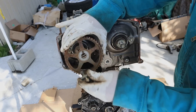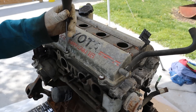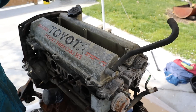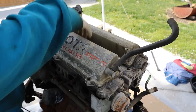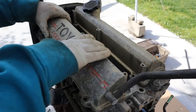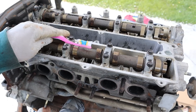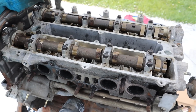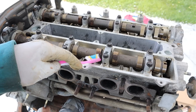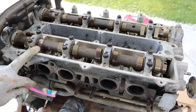Let's remove the camshafts. The valve covers on these old Toyota engines use just Phillips screws with not much torque. There's a spacer here for the spark plugs and actually two separate valve covers. With the valve covers off, you can see things are pretty clean inside with not much oil deposits, which means this engine was sitting for a while. You can see some of the cams have rust marks — there was probably some condensation inside causing rust while sitting.